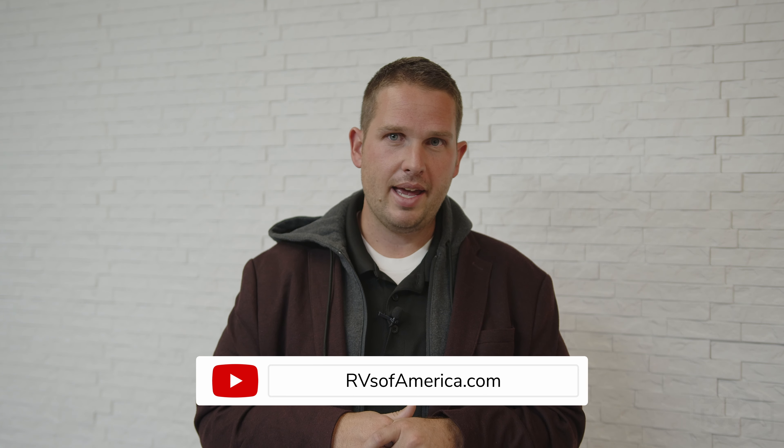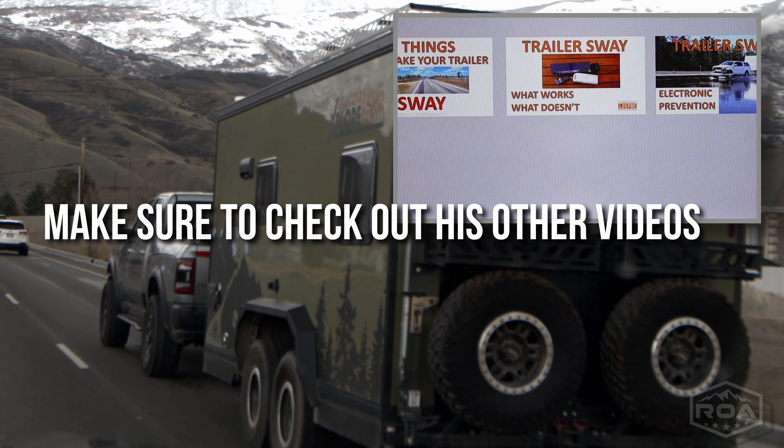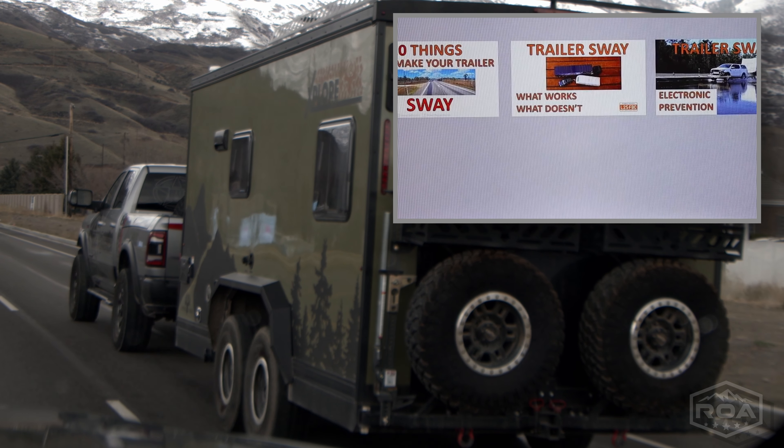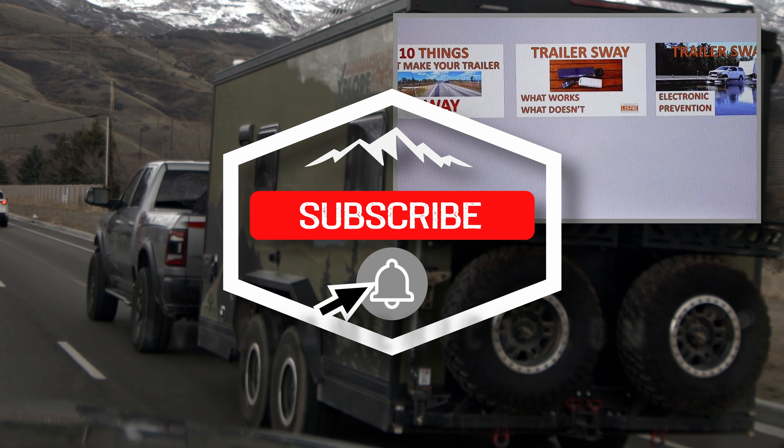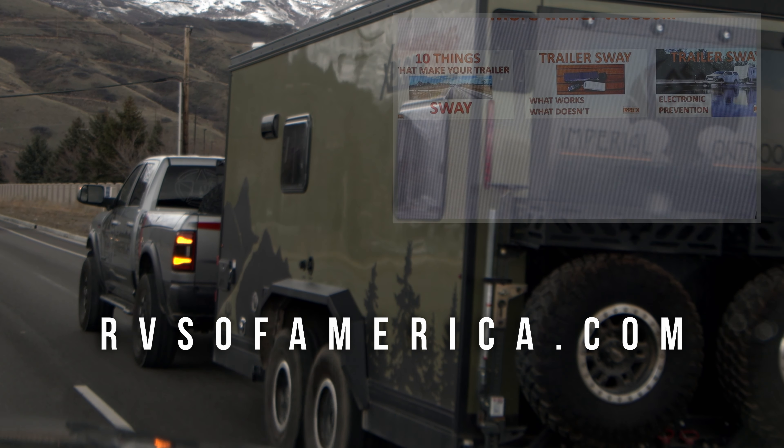Try to go overkill. We often get calls from someone wanting to tow a trailer whose max weight is 8,000 pounds and they say their truck can pull 8,000 or 9,000. That is a recipe for disaster. Just because your truck says it can pull 8 or 9,000 pounds doesn't mean you should. If my truck is rated for 8 or 9,000 pounds, I feel like 5,000 pounds loaded is the max I'd look at — and I'd prefer 3,000 to 4,000 loaded and not go over 5,000. Some people say 50%, 40%, some say 90% — I don't agree with that last one. Nevertheless, it's always better to have more vehicle than trailer.